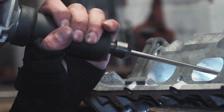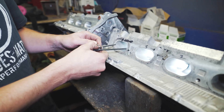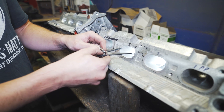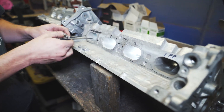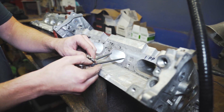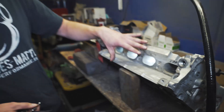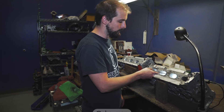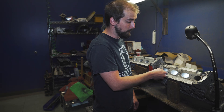Let's just say I go, okay, and then I go in here, okay. Touching, touching. So stage three is a street port, so I use this port diameter for my stage threes, and then my stage five is fully opened up. It's hard to see it, but knowing what you remove — I know that this one is significantly bigger than the other, probably by a quarter inch.